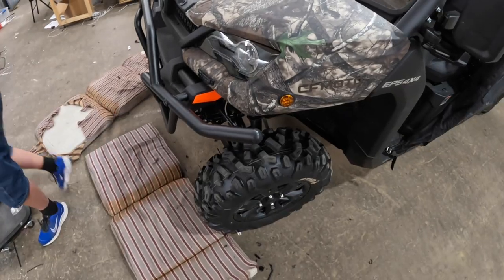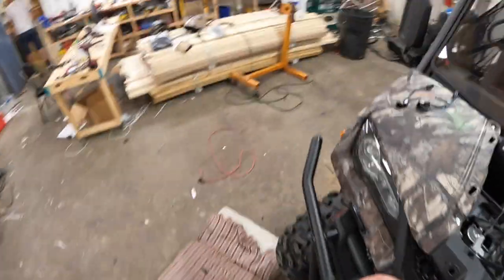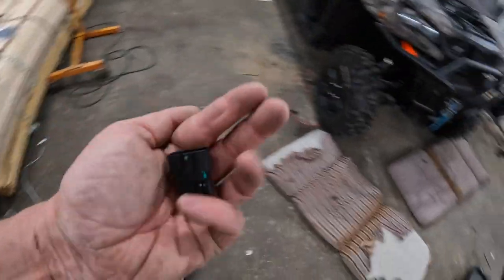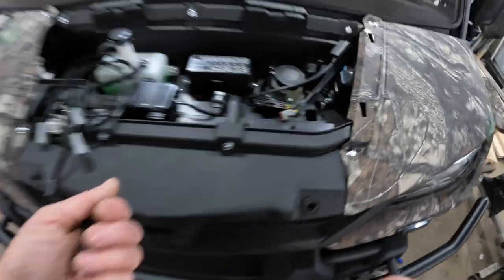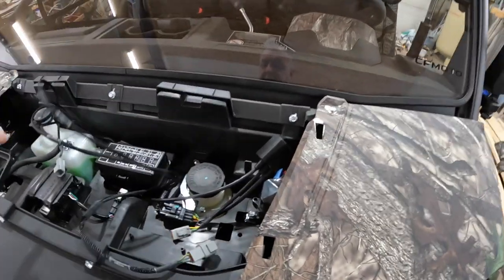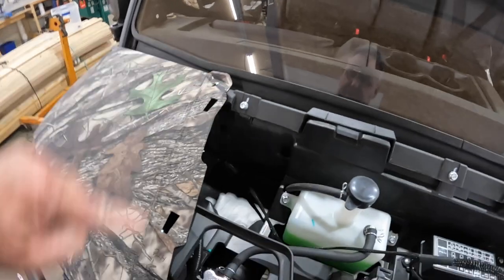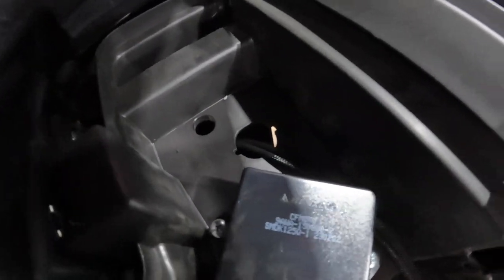The lights are now here. We're plugged in up here, and a little flat blade screwdriver works good to take that out — that is just a dummy plug, kind of a cover. You're going to pull that out and then plug our harness into it. Ours is now plugged into the brake controller down below. To run the front harness, take these two 10 millimeter heads out and you can get down — there's a hole on each side right there, which will bring you right to our lights. Hook those up and do the same to the other side.